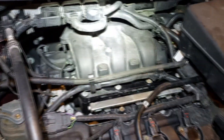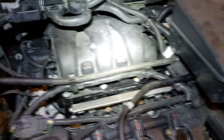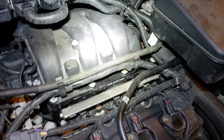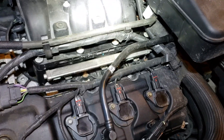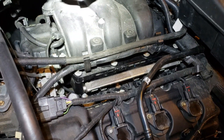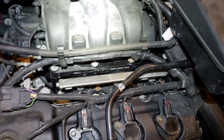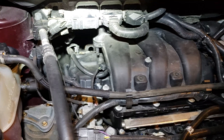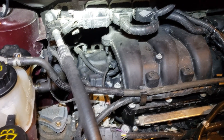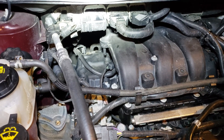I hope this helps people looking to change out the rear O2 sensor. One piece of advice: get the good O2 sensor removal socket. The easiest way to get them out, if you're changing them, is to just clip the wires and use a deep well socket, 7/8 — that worked the easiest. But getting it back in, you'll still need the special socket to go past the wire. Anyway, thanks for watching, bye.